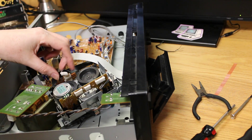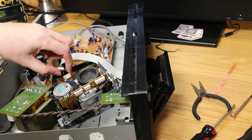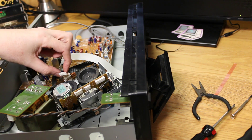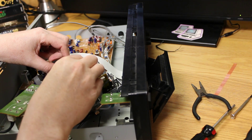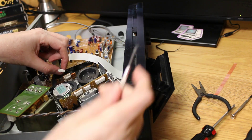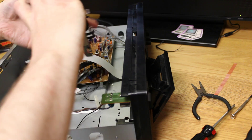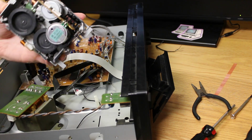So I was able to remove the wire for the little tape head spinning unit. This is pretty tricky because it's very loose — it's just held on by a little bit of plastic and has all these ribbons. What I ended up doing was taking a screwdriver and working it in the edge, prying this up, pushing it up and then pulling it up — that worked. So now I should have this free and the whole thing can come out. There we go — that's the tape drive unit itself.